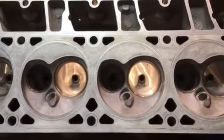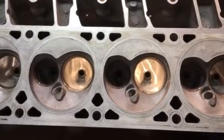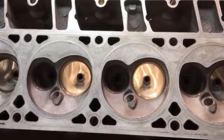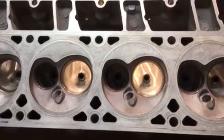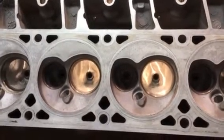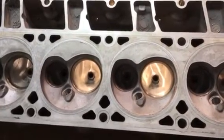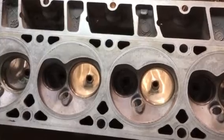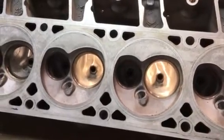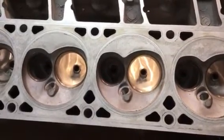I wanted to make sure I had that added into this series, installment number three on the LS 241 heads. These are done and delivered as soon as the customer can come pick them up. When finalizing my sanding roll work, I like to go over them repeatedly to nail the transition from my valve seat to my bowls, making sure there's absolutely no lip or catching point for the air in or out, to make sure everything is up to my satisfaction. Thanks for watching.